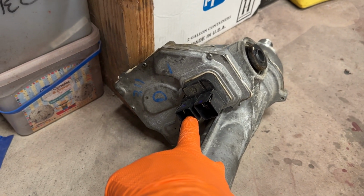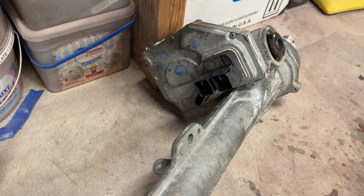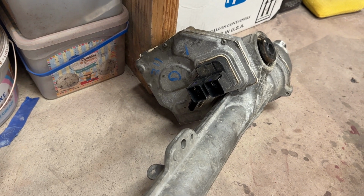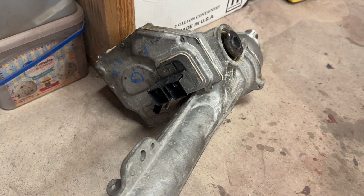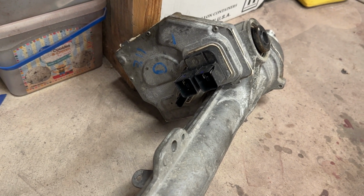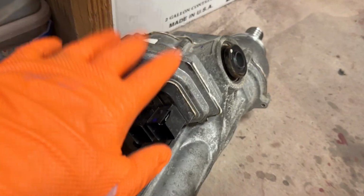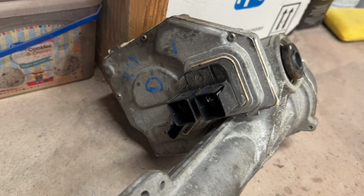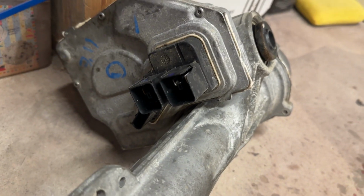The issue we run into is that if we send a CAN bus signal to turn the vehicle around a very sharp curve, when we're done going around the curve and we send either 0 or a signal in the opposite direction, it still doesn't straighten up. It continues to turn. There's something going on inside the logic inside this box where once you've sent it a big signal, it doesn't like to recover from it and start going back towards 0 or the other way.